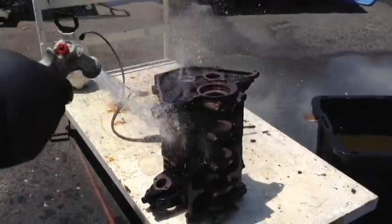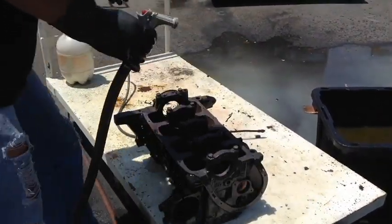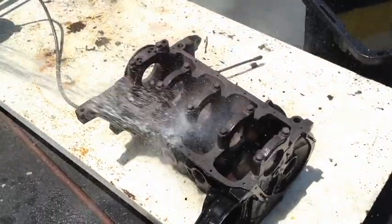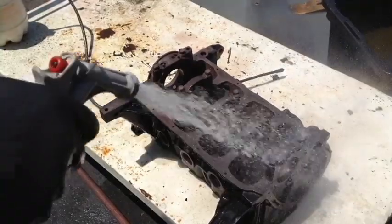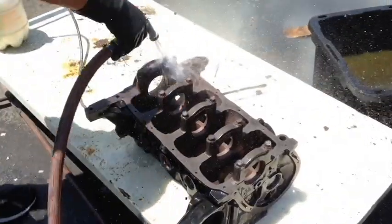This motor right here, when it's all done, you can go ahead and machine it — line and bore it, bore the cylinders out, whatever you want to do. It's ready. If you don't want to do it right away, you're just going to sit there and spray it with Dr. X metal sealer, put it in a plastic bag, and it will sit on the shelf until you actually need it or until you build it for your next job. Great job.